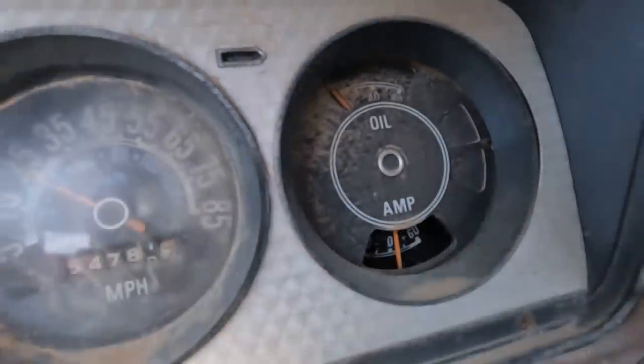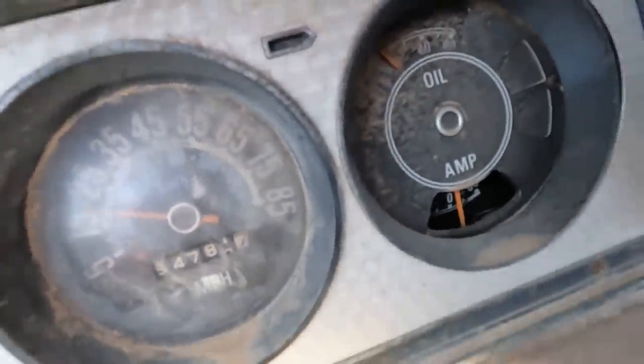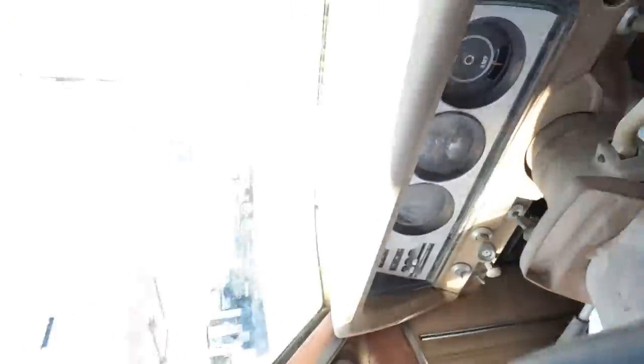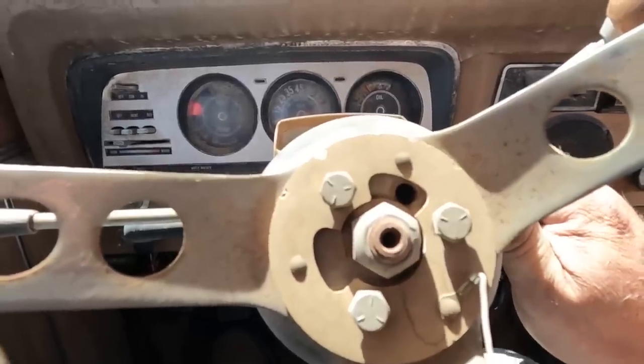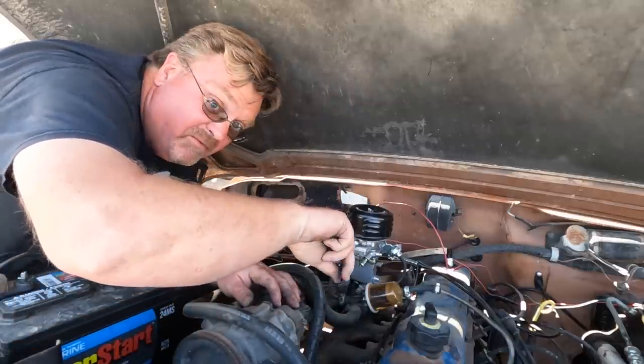Well, we're going. Check this out. At this point it starts up and dies within a few hundred feet. So I'm thinking when I added the fuel tank in — I'm back to the original tank, cleared out all those mud wasps out of the lines — I'm betting there's some residue there and it's probably clogging up the filters.